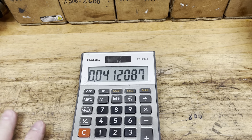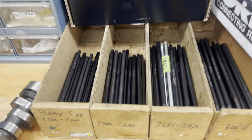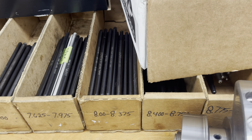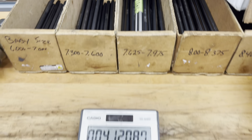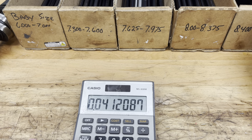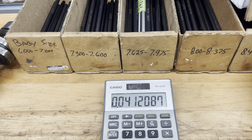Everybody brings up push rod checkers — you cannot do this with a push rod checker; it will bend under real spring pressure. This is the hard part: we have boxes of push rods and we check them with real push rods. Rather than spend hundreds or thousands of dollars on push rods, buy a push rod checker to get yourself close, then buy a size up and a size down before you commit to a whole set — and you can accurately figure this out.